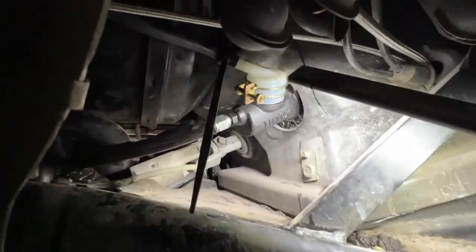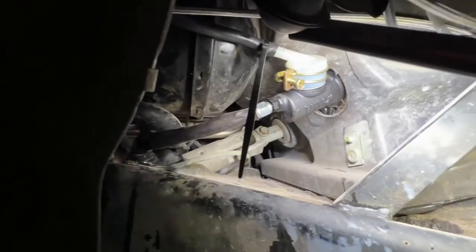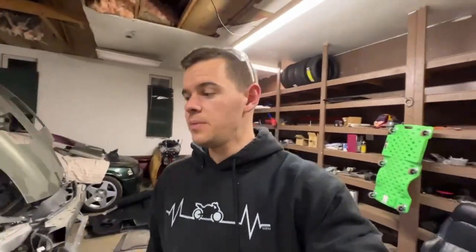I was gonna keep working on the car but I'm for sure done for the night. There she is — got the cover on tightened down, stock hose, and then the other line that goes to the slave plumbed down there. Should be a piece of cake plugging that quick release in once I get the torque tube and trans back in. Once that's all done, hopefully she goes into gear easier and is reliable. Unfortunately I ordered an ECS spool kit for the diff and it hasn't even shipped yet, and I'm done with everything else drivetrain related.